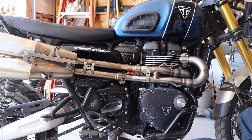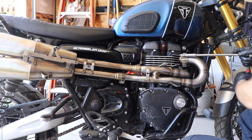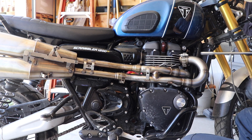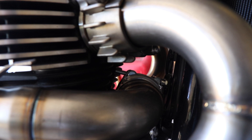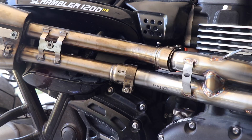I'm going to start with the header — obviously with this you go a little on each side so it's nice and even. When you're tightening up the cross pipe clamp, be careful because that bolt is going to get longer and you don't want to drive it into the cylinder head. You have to rotate it downwards — you can see that the bolt for the band clamp is about three eighths of an inch away from the cylinder head, and you can just fit a ratchet wrench in there to tighten it up. Once you're done with that, tighten up those band clamps and then tighten up the rest of the bolts in the back.